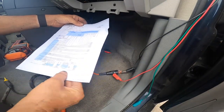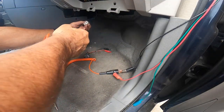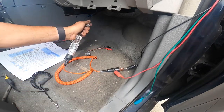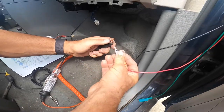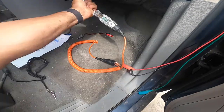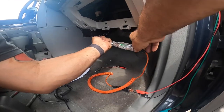Now let's check if that dark blue wire is hot — and there's no power going there at all on that dark blue wire. Let's check the ground side: we're going to disconnect it, hook it to the positive side of the battery, touch the wire here, and we have 13.9 volts — so we have a good ground.